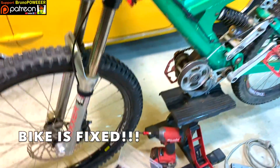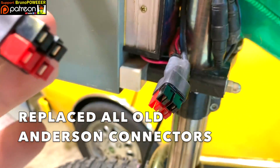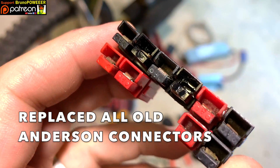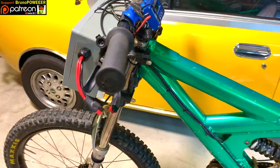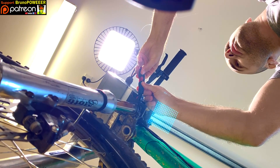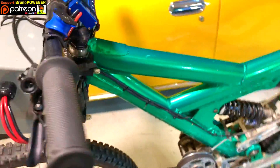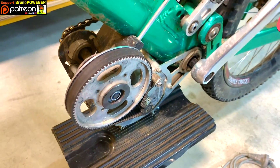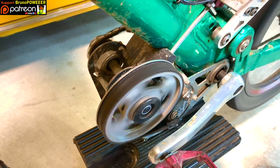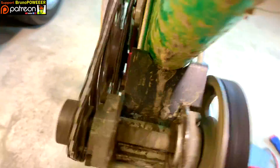I just finished fixing the bike so you can see the motor spinning. I did a bit of tidying up, put the cover on, organized the wires, put in new contacts - that was the problem. Look at the old crusty ones - they're disgusting - the black one is completely melted, can't even see the contact. I'm just going to turn it on, did a bit of soldering, put the wires back inside. I need two hands - bike is on! The motor controller is on. Let's check the high-tech display. No power at the moment, so let's run the motor - I'm going to spin the throttle, you're going to see. Wow!